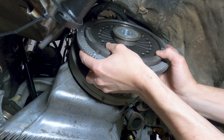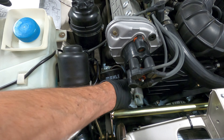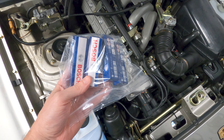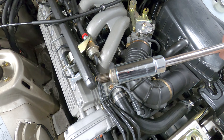A few other odds and ends cared for during year five include replacement of the oxidized lower rear shock mounting bolts and washers for $37, the right interior light door jamb switch and rubber seal for $24, and the lower balance shaft inspection hole plug on the belt cover for $2. Towards the end of the year, I also performed another oil and filter change with Valvoline's VR1 20W50 oil and Amsoil OC142 filter for $64, and I replaced the spark plugs yet again for $7. This completed mechanical repair and maintenance items for year five, which came to $4,623.32.